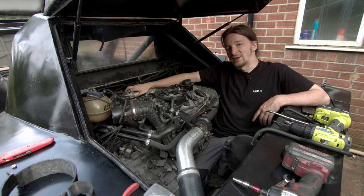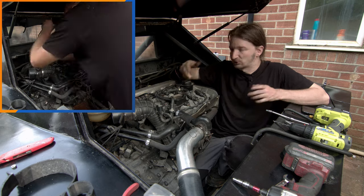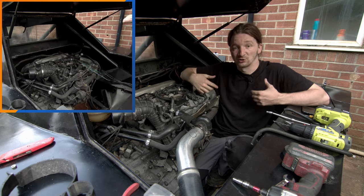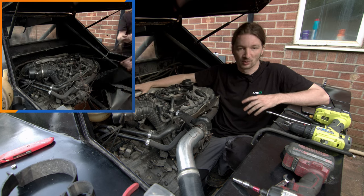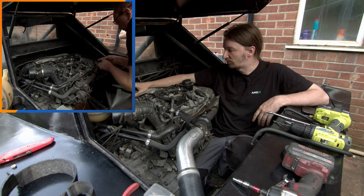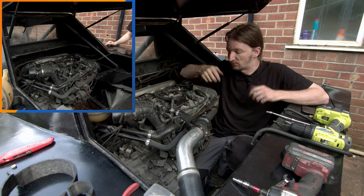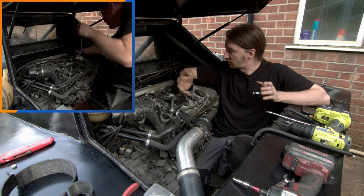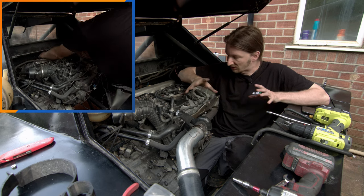This stage was a bit of an adventure. We ended up digging a lot further into the engine loom than I really expected when we started out, but we've peeled a lot of it apart, branched it off to new places and routed it in ways that make a lot more sense for us. What VW Audi did when they built this engine — this harness was probably quite sensible for their requirements — but we need things in slightly different places, so we've sort of split things apart and changed things around quite a lot. And the result is all around me right here. My knees are also in a lot of pain, but that's my own problem.